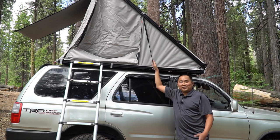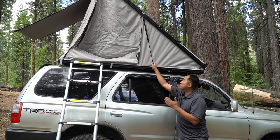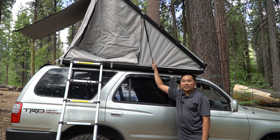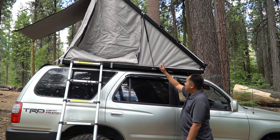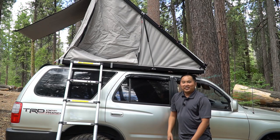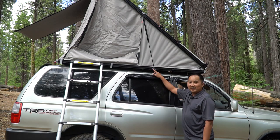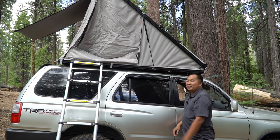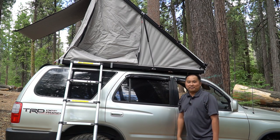Let's talk about these shocks. I got these on Amazon — they're an Amazon special, $36 for a pair, and they're 80 pounds of force each. I thought it was going to be too much, but if you adjust them properly and plan on loading your roof — like I have a solar panel on top — they work out just fine. I don't suggest you get any more than 80 pounds because the stronger they are, the more likely your wedge is not going to be a perfect rectangle. I used a heavy duty ball mount here — it takes a 10mm ball on the bottom and top and you can adjust it left and right depending on how strong you want it.